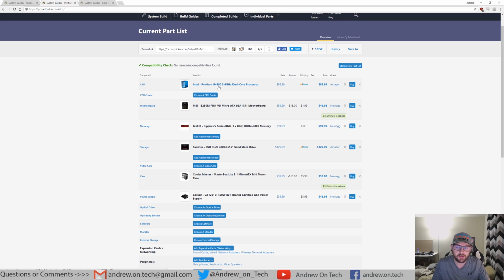So I ended up going with the G4600. It was the best CPU that I could get for the price of this build. Also, I found it in a combo with this MSI B250 motherboard, so I scooped those both up. Again, same RAM as on the previous build, one 8GB stick, for the same reason: later in the future I can bump that up to two if they ever start running into issues with using too much RAM, too many Chrome tabs. I can always grab them another 8GB stick, slide it in there, boom, now they're at 16.